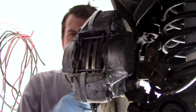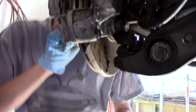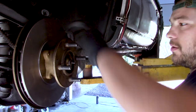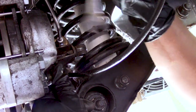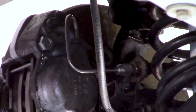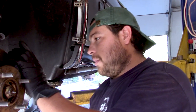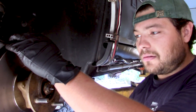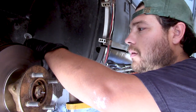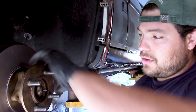We just put the new brake pads in and we put the pins in and we're just clipping them up right now. We're not hitting any caliper — it's just the pads. It still spins freely enough. This is a new stainless hard brake line that was included in the kit and it replaces the regular steel one that usually is on the car, so it's just a nice little upgrade to do while you're at it. We now have the caliper in with the spacers, the vented discs, and everything is nice and tight. We just finished installing the stainless steel brake line from the caliper to the main line, and as you can see everything spins freely.